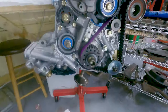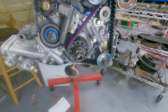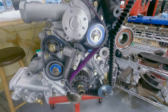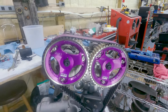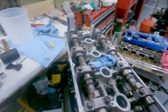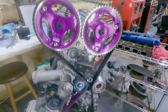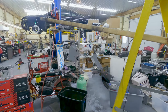It's timed and tension set. The pin moves freely in and out there. So what I'm gonna do is I'm just gonna let it sit for a while and chill, and then I'll come back and run it around again and check it. But yeah, everything moves really, really smoothly and easily, but not too easy. Still good compression. But yeah. She's timed.